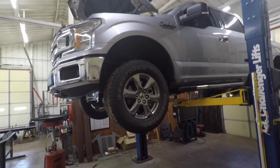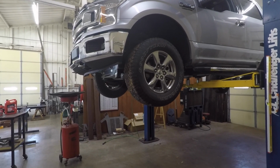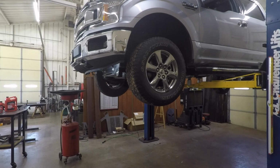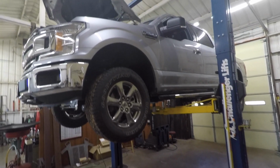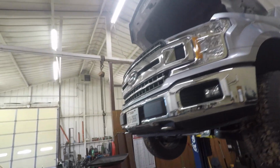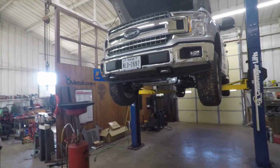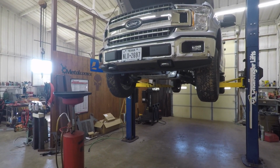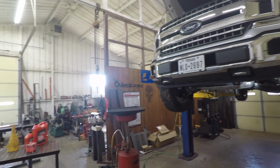I don't remember if I discussed that, but I have 3,200 miles on this truck now, so I'm going to go ahead and do the first oil change at 3,000 miles, just in case there's any break-in deposits or debris, foreign material, whatever, from the engine wearing in. Probably not, but just in case, that's what I feel comfortable doing, and then I'll be changing it from here on between 4,000 and 5,000 miles. That's my personal opinion, through experience and what I feel is best.